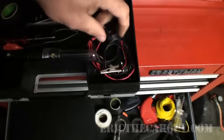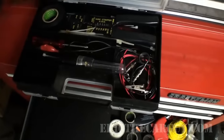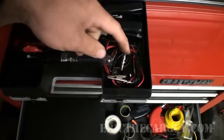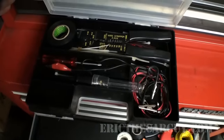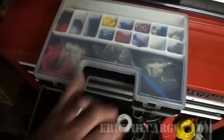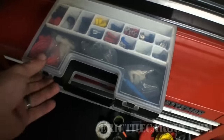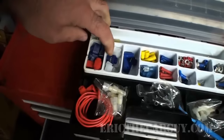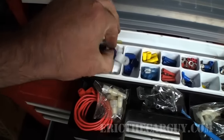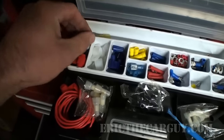This was just a basic electrical set that I got. Wire strippers, a little test light. You know this from soldering videos. Also just wires and alligator clips. There was a time before the days of scan tools where you actually had to go out on the vehicle and hook different things up and do your own actuating of devices. Zip ties — always a good thing to have. All the connectors, stuff if I'm doing electrical repairs. I've got a lot of these because I don't like using them — these things are a connection problem waiting to happen in my opinion. I would avoid using this type of connector, but it came in the kit, so there you go.